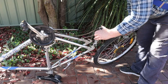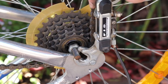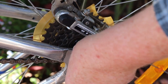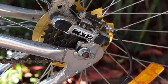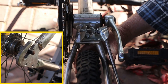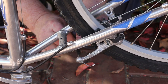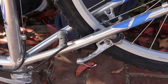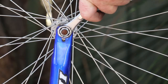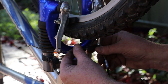Now for the mountain bike wheels. For the rear wheel, hold the derailleur back with your left hand the same way as before. Place the wheel sprocket on top of the chain and let it drop into the axle slots. Now fit and tighten the nut on the chain side of the wheel. If the wheel isn't properly centred in the frame, use one hand to pull the wheel straight while tightening the other axle nut. It's a very good idea to reconnect your brakes as soon as you've refitted the wheel. Now we can refit the front wheel — the safety lugs go first, then the axle nuts. Tighten both nuts firmly, then reconnect those brakes right away. You don't want to remember this part halfway down a hill.